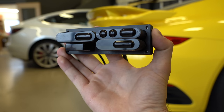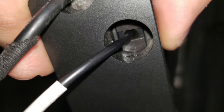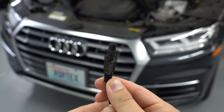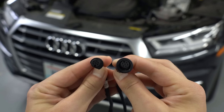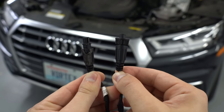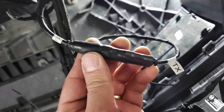Next, let's move on and talk about laser jammer upgrades. I did some upgrades to both the ALP and to the TMG system. Starting off with the ALP, I wanted to go ahead and take the old TX heads off my car and replace them with the new TX black sensors, which improved the jamming capabilities. Out in the front of the car, I've got these special modules that are built to house a bunch of different laser jammer heads. It wasn't really possible to remove the old TX heads, so we actually had to trim off and shave off part of the twist lock connector in order to remove the connector from the laser module. They had to do the same thing with the new TX head as well in order to slide the cable back into place. Afterwards, they covered everything back up, protected it with heat shrink, and made sure everything was good to go.